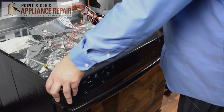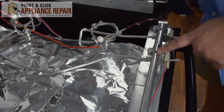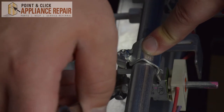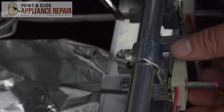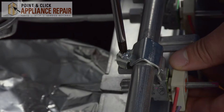Next we're going to pull the front panel away. Once you remove that front panel on the range, the small burner valve is going to be located right here. To begin your repair, using your half inch wrench, disconnect the burner tube from the burner valve. Next, using your Phillips head screwdriver, we're going to unscrew the clip that's holding the valve to the manifold pipe.